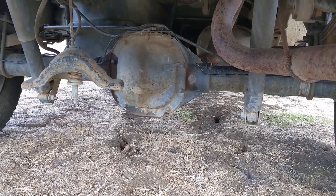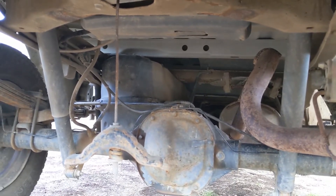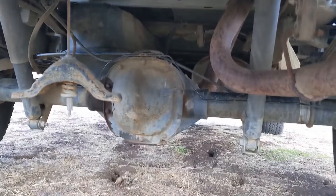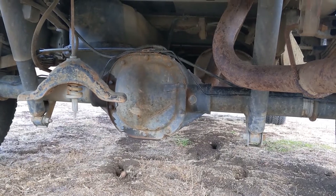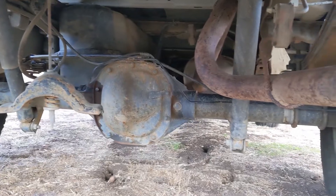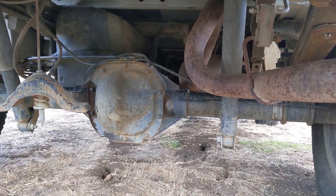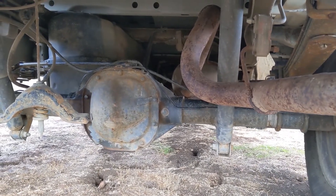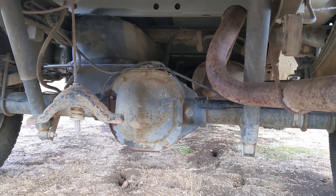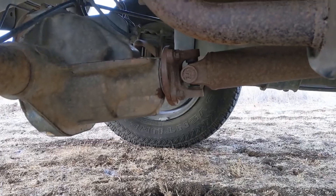Through a motor — and as you can see, there's all this space here. You would have to get rid of the spare in the back, but I would rather mount the motor between the frame back here, feed power into the differential through a drive shaft. Basically, you just flip this on the sagittal plane — rotate this all the way around — and you can maintain a solid axle, bolt it to the frame, and just feed power from a motor that sits behind the rear axle. That's how you would power the rear axle, with just a U-joint that feeds into the differential.